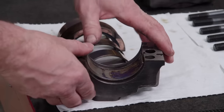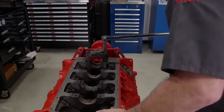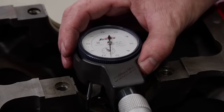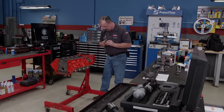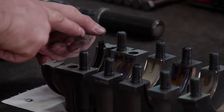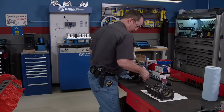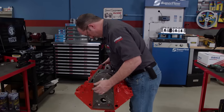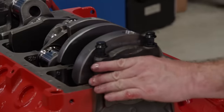The main bearings are from Speed Pro. Once the mains are installed, we'll check the main bearing clearance — we're in a good range for this application, between 25 and 28 ten-thousandths. We install the new rear main seal offset to the block line; it helps prevent oil leaks since a solid piece of the seal covers the break between the cap and the engine block. The bearings are coated with Permatex Ultra Slick Assembly Lube and the crankshaft goes gently into place. It's a SCAT 4340 forged unit with a 4-inch stroke — that's an increase of 420 thousandths over the stock crank, which is 3,580.